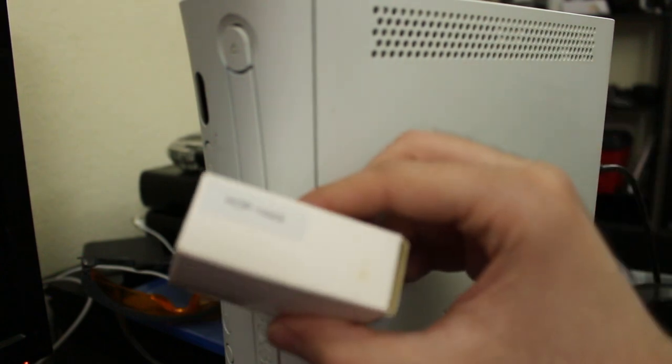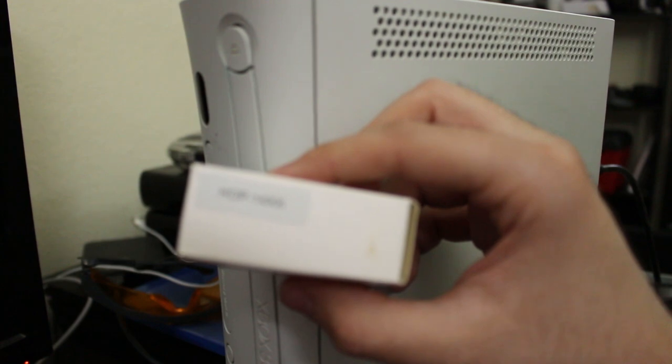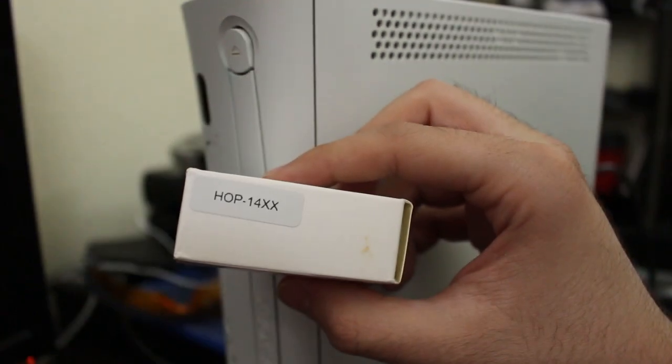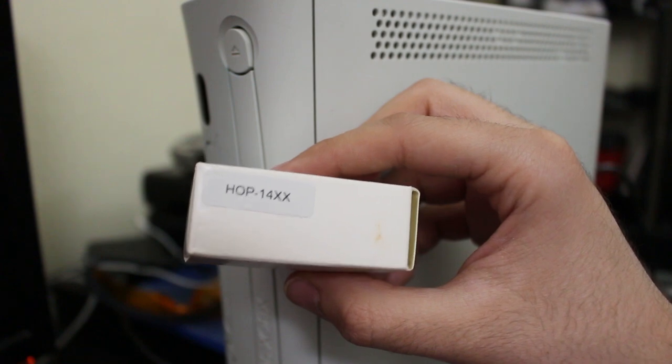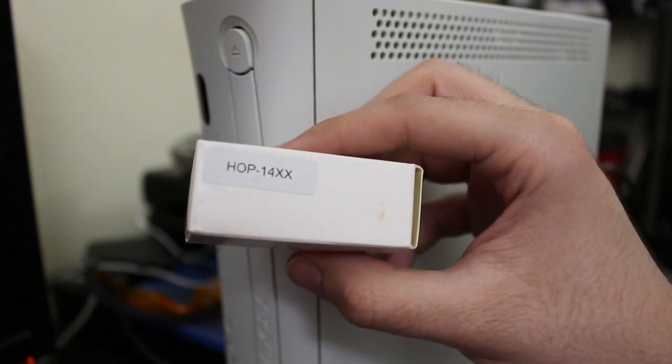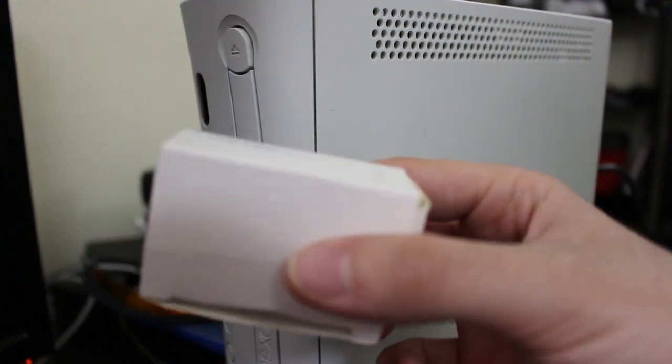Now that we've diagnosed it, I believe it's going to be a broken laser. So I actually have a replacement laser right here. This is a HOP-14XX model laser that I just grabbed off eBay. You can get these for less than $5. I paid just under $5 for this, with free shipping within the United States. So I'll remember to put a link down below in the description.